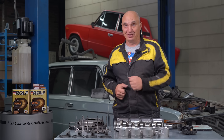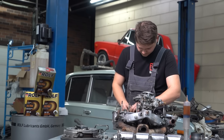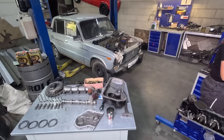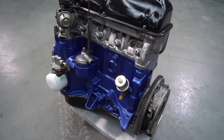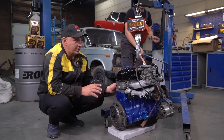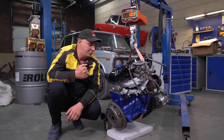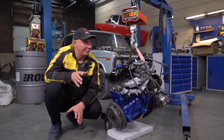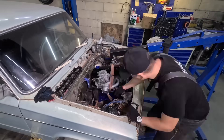Assembly and back onto the scale. The engine is back together, everything is looking very good — looks nice with the paint. And now the moment of truth: bring it up, let's see how much it weighs. So it appears as if the engine has lost 8 kilos, though we worked out that it should have been 6 kilos. I guess it's because we cleaned everything off — that's what makes for such a difference. But what we want to find out is how all of these measures are going to affect engine operation. So we are going to go ahead and fit this to a car, start it and see how it's able to run.